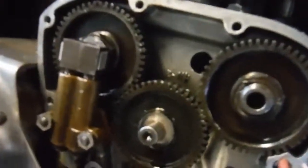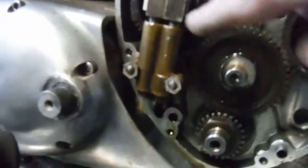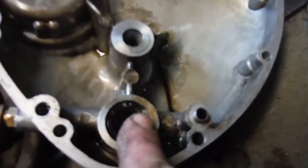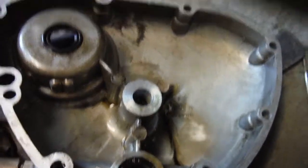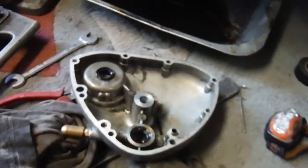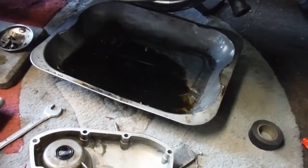As you can see, there's the oil pump. The gasket behind it was bad. The oil pump pumps oil out of this hole into that hole there, and the timing cover along that passageway, and then a seal keeps the oil in that chamber there, which fits over the end of the crank and pushes the oil into the crank. So I'm hoping I'll put this timing cover on and oil pressure should be restored. All being well, we'll soon find out.